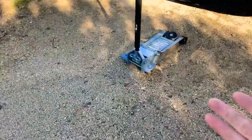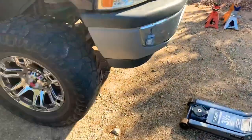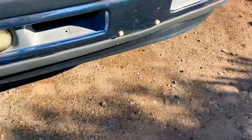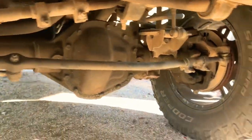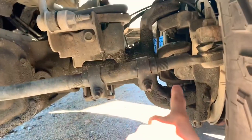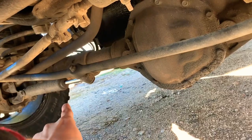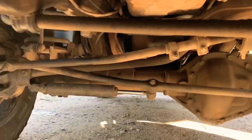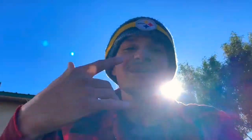It's been a couple days and we're back. I got some jack stands, a hydraulic jack, and all the parts right here. We'll start off by loosening the lug nuts off the wheels, take them off, jack it up, put the jack stands under. Seems pretty simple — I've watched a couple YouTube videos, never done it before. I know you count the threads on the tie rod because you need an alignment right after you change this out.